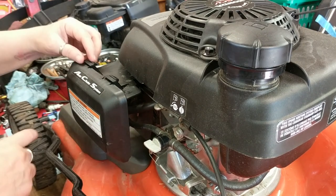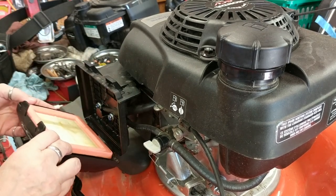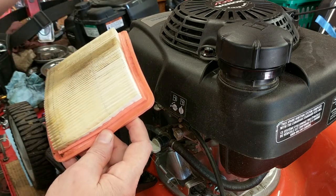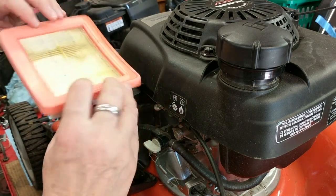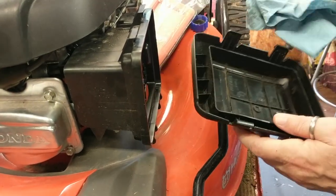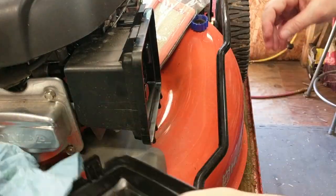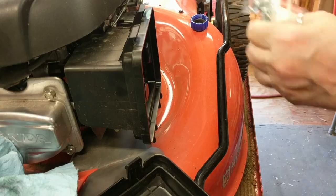The next thing is to check the air filter. You push in these two tabs right here and then the air filter cover hinges off. I can see that this one actually has a lot of dirt in it and a pretty fair amount of oil all over the filter. That's either from blowback from too much oil, or it might have gotten turned over on its side to clear something from underneath it. Either way, we'll be replacing that filter. I've wiped out the inside where the air filter goes — hit this with compressed air if you have it; otherwise, just get as many of the big bits of dirt out as you can.